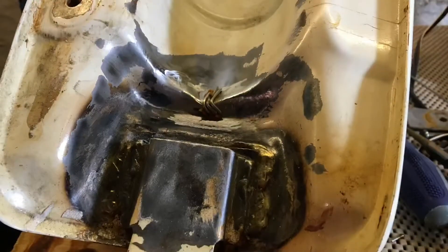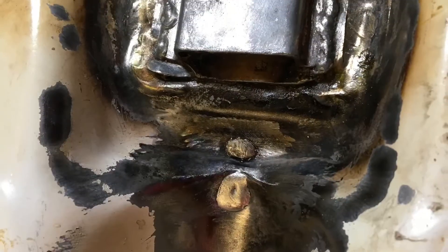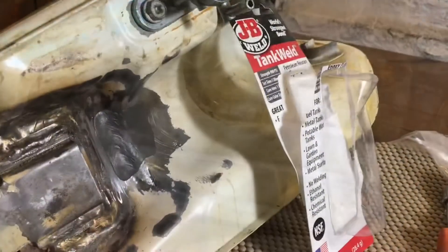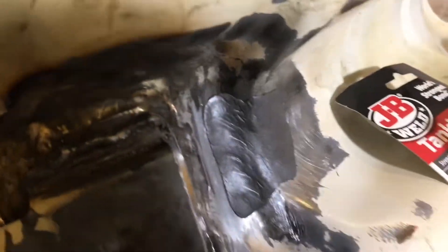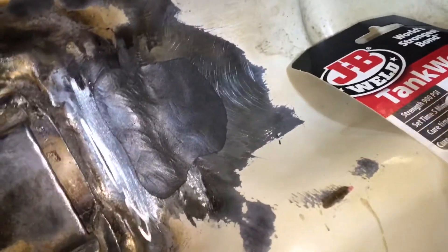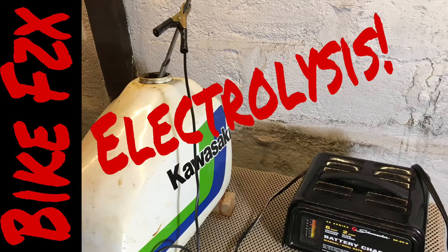You can take off the block plate and use a simple hair dryer to dry out the inside. Once it was really clean inside and out with no fuel vapors, I tried to solder it, but the solder didn't go where I wanted it to — built up a couple little pools but did not seal it properly. In the process I found a missing socket my two-year-old had put in there. I ended up using JB Weld tank repair. Looks pretty good — solidifies up really well. Electrolysis and my little hooks cleaned out the tank, and on the outside I used JB Weld. It is sealed — let's hope it stays that way.